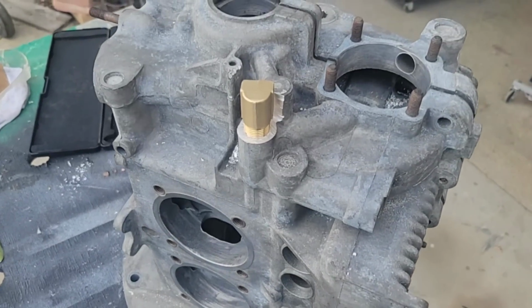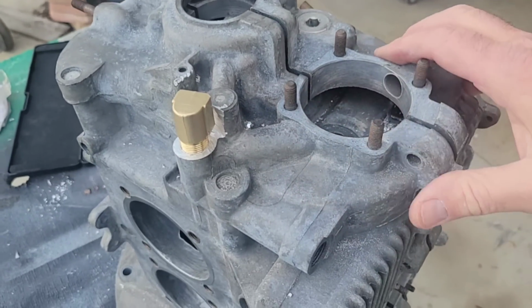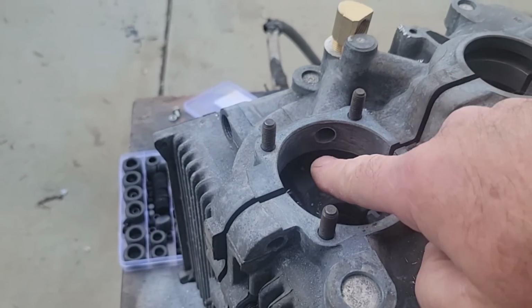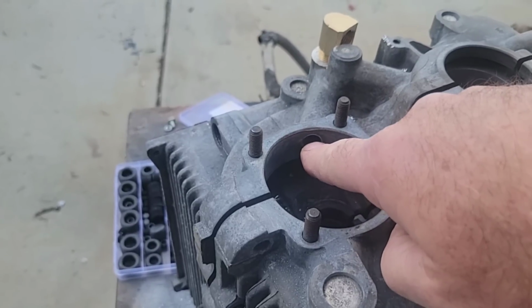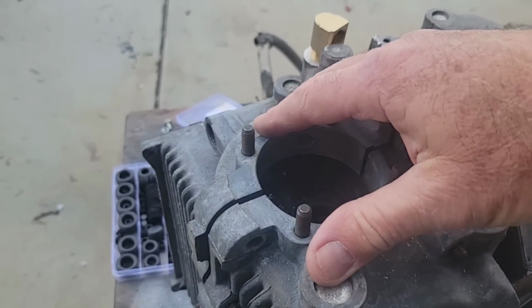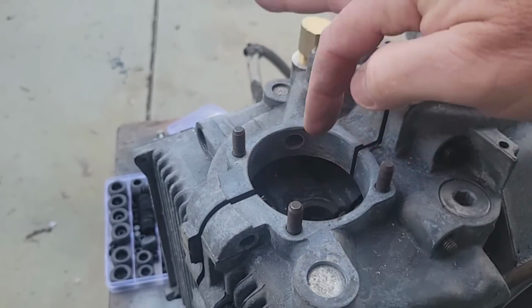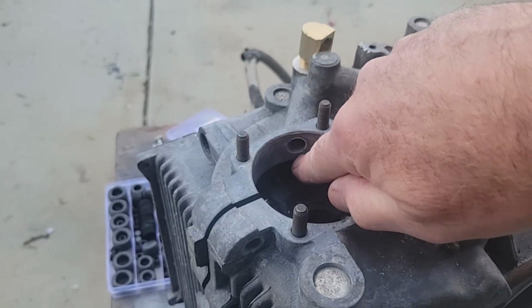Anyway, next thing we had to do is do the pump. So we'll do the pump, okay? And if you're using an aluminum case, and this is where you use discretion, some guys will put a plug in this one too. So if you want to put an extra plug in there, you can, or you can just do the pump. If it's a mag case, most of the time, if it was really nice and tight, this one looks like it was super tight and had no issues. Okay, so the pump fits really tight in there. If it fits really tight, it shouldn't leak out of here.